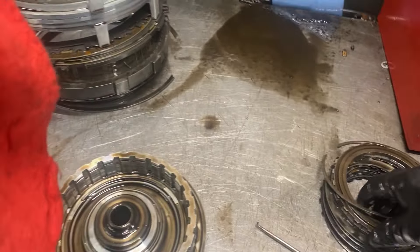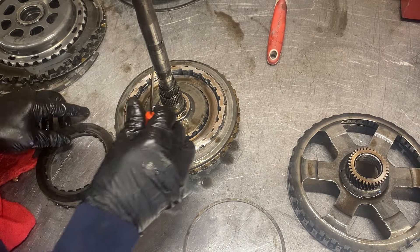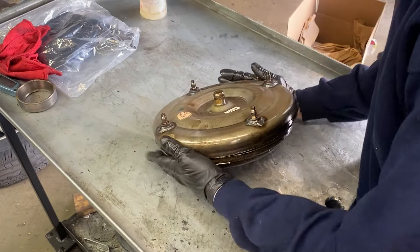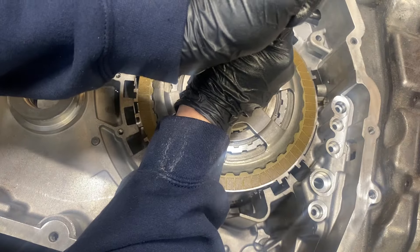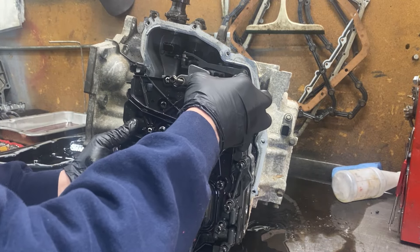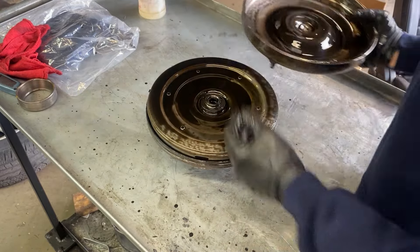We got the transmission all apart — now what is wrong with it and why wouldn't it move forward? It's pretty simple actually: we just have a set of burnt 4-5-6 clutches. I'm not sure exactly what they do in first gear, but obviously it's not allowing the car to move. We also cut the converter apart just to check the clutch because they are problematic in these units, and the clutch was completely gone inside the torque converter. So we had a burnt up overdrive clutch, a burnt up torque converter, and no forward movement. This is a common problem when these run dry on fluid and people just keep driving. In my next video, we're going to be putting this transmission back together — buying everything we need, possibly a valve body, torque converter, a full clutch kit, and clutch steels. Be prepared for that video coming out.